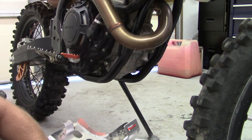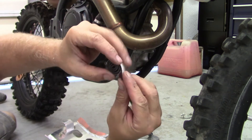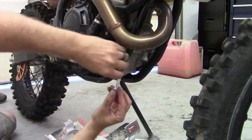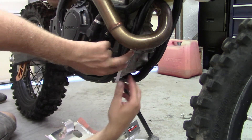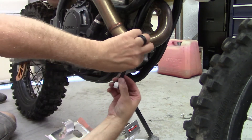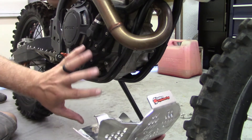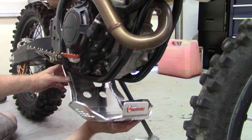They give you this foam tape in a roll. What you do is hold the skid plate up, mark where it's going to lay against the frame, then take this sticky tape, peel one side, and put it on the frame - down the rail, under, across. Anywhere that this thing touches, if you don't do that, you're going to get vibration or weird resonation coming up through your frame. The back frame rail is not tightened yet - you let that have some play in it.